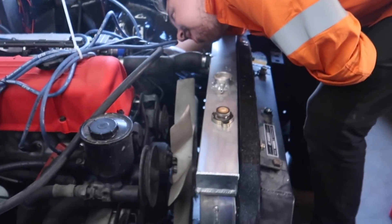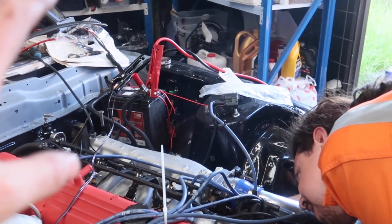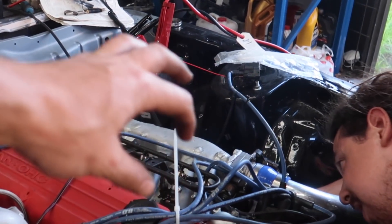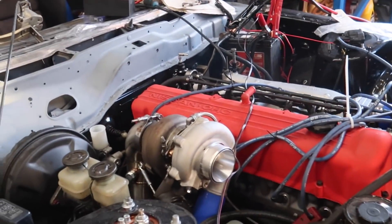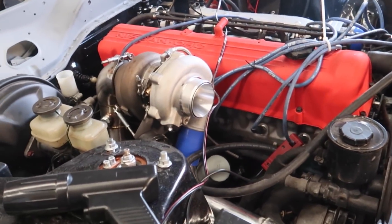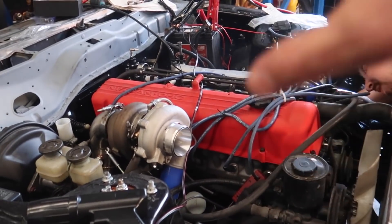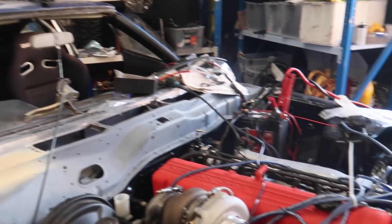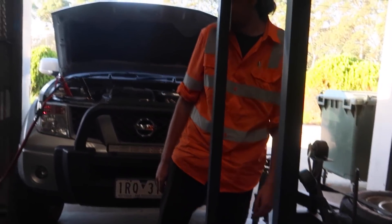We were just going to get it running and call it a day, but you know it just never happens like that. We put the water hoses on and we put water in the car so that we can continue to get this thing running super smooth. Ignore the smoke coming up from under the inlet manifold - that's where the exhaust manifold is and we painted it black so that's just the paint setting in. We haven't had any issues, we're just literally dialing in this timing. Now the car's got water we can make sure the coolant temperature sensor is working in the Haltech and the engine's going to stay cool while we're running it for long periods of time.